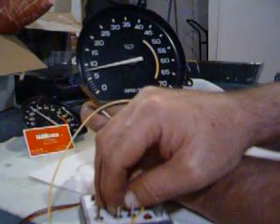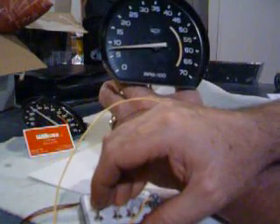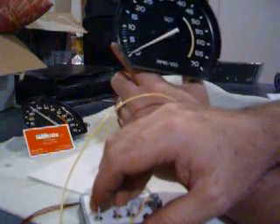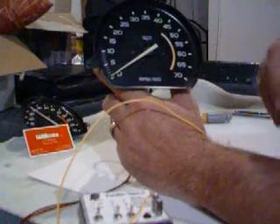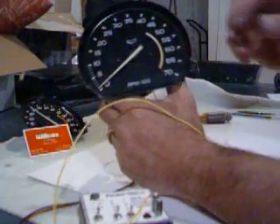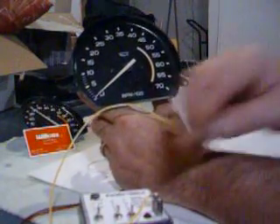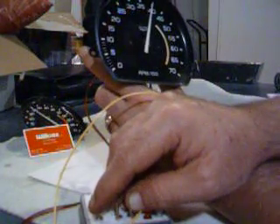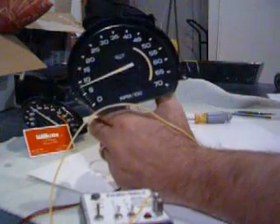Going back to 700, I'm just a smidge ahead, which may mean my zero set is slightly off. When I turn the signal off, I'm just a little bit off my zero set. Typically, you'd want to redo your zero set and then check your tachometer again — that's why it's important to make sure it's sitting on zero before you fire it up. If it's not on zero, it changes the scale all the way across the board. This board that we just took out of the bag is within 50 RPMs at just about every setting: 3,000, 4,000, 2,000, and 700.